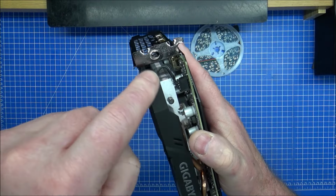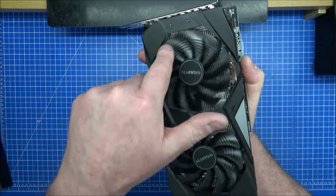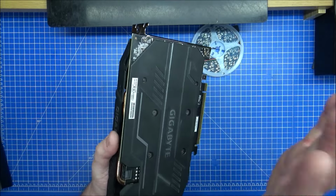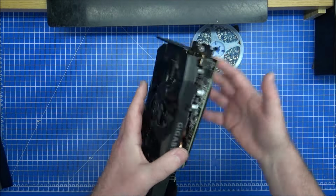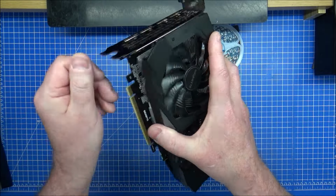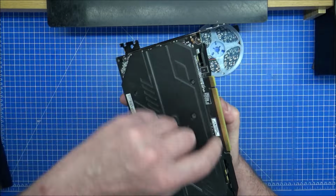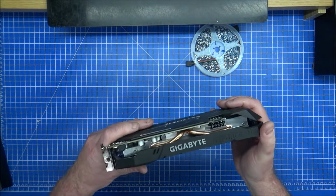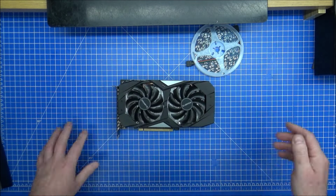Make sure to take this pin header off, because that's going to be the power controls for the fan. So a very easy strip down. I'm not going into taking the boards out. I'm going to give this a blowout while it's out of the case. But to be honest, it's actually pretty good. Tiny bit of surface dust, nothing major to do. So I'm going to take the 4 screws out, get myself tidied up, and let's start chavving up this graphics card.